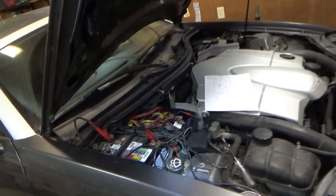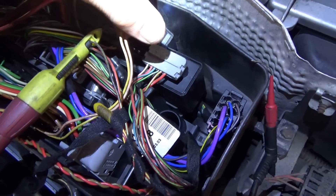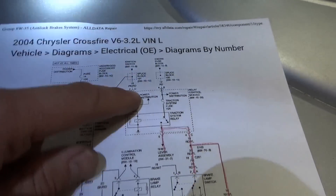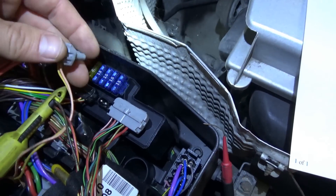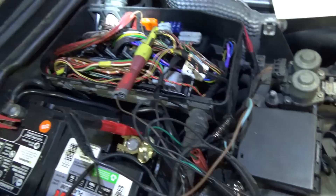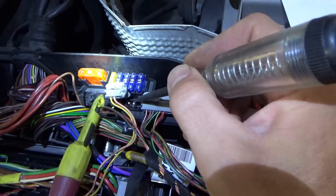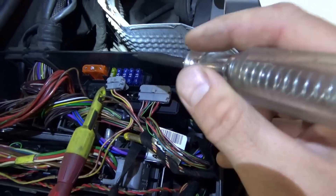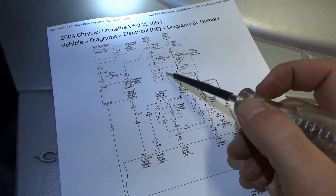Car's in the shop — it's not a beached whale anymore. Let's see what's going on with this relay control box. I have the input unplugged. The input is the pink and red wire on pin 2, connector D — that's the ignition turn-on control wire for that relay. We can take a test light from battery positive; if it finds ground it will light up. Let's see what happens when we touch that pin — something clicks inside.